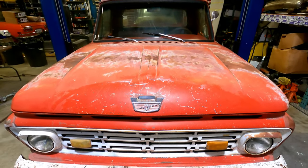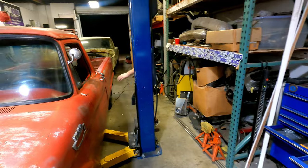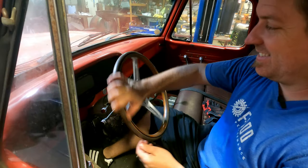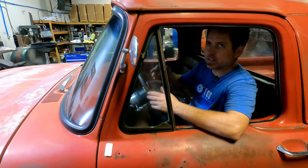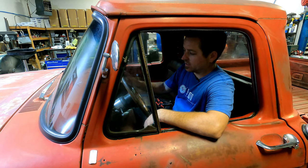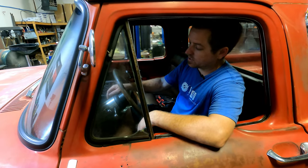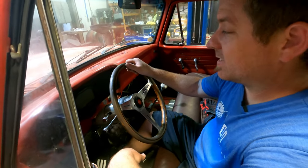Got her all wired up and in there — ready for the moment of truth. The truck still doesn't run, but I've got power steering now. With the old Crown Vic hydraulic rack there was no assist since the engine wasn't running, but look at that — totally smooth. I had problems before where I'd lose power steering and it would catch and not be smooth at all. The only thing I've got to do now is get rid of this cheap China steering column because all the play is in the U-joint — they're plastic, and when they break, you lose all your steering.